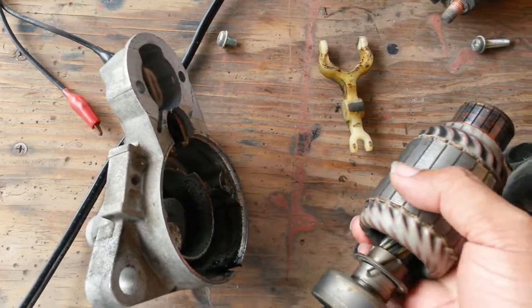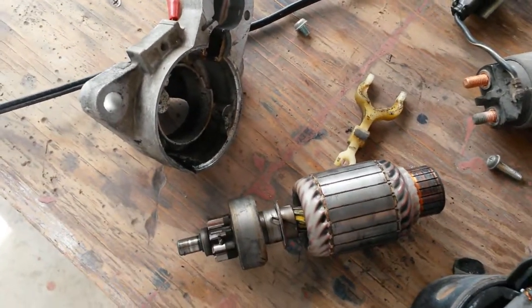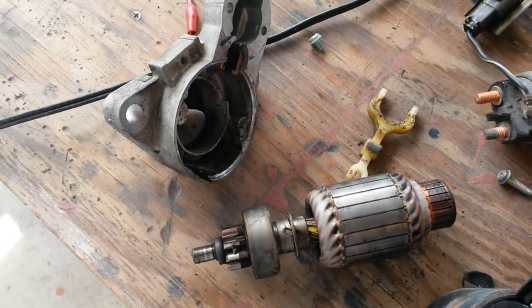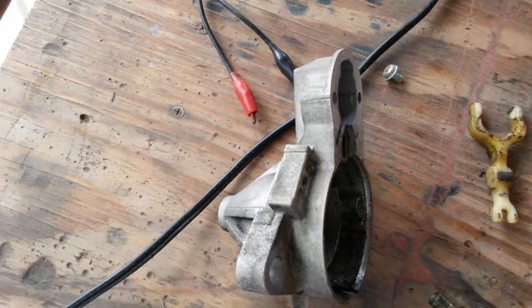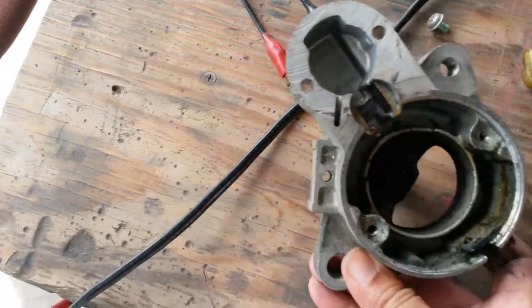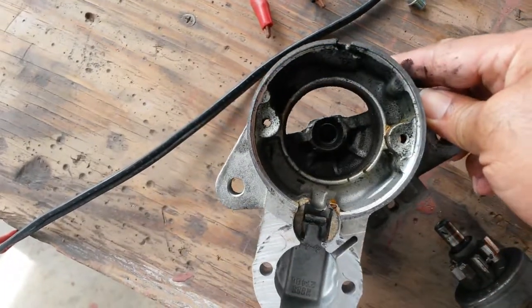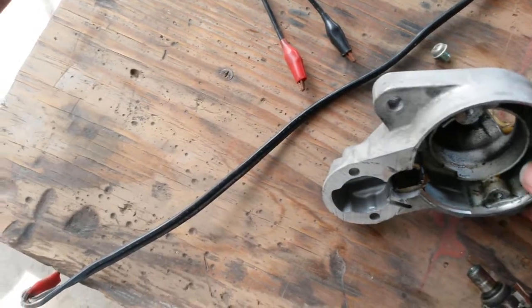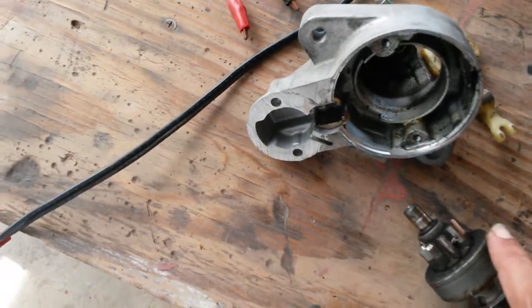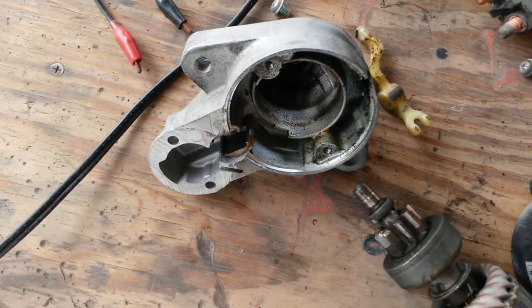I haven't tried it on a car, and the computer power supply, I was unable to run it because of the kind of power draw this is going to pull. It's just going to strip the supply, it's going to see it as a dead short. This side again, bushing, and if you look inside there, bushing, not sure if that's visible, is it? Barely. Anyway, bushing, no bearings, aluminum housing, light, steel pinion, probably quite a good thing.